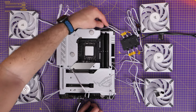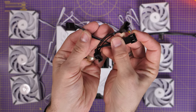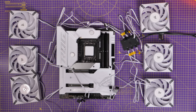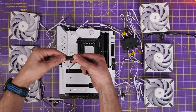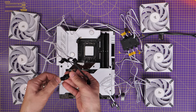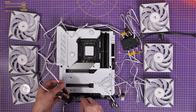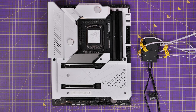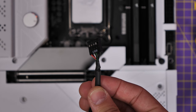You can see I'm filling up multiple motherboard ports quickly, but there are options. I have a separate additional splitter that takes three fans and connects them into one power cable, allowing three fans to share one header. These splitters are an additional purchase — they don't come with the fans or motherboard. You can also get Y splitters for two into one. You also need to check your motherboard's voltage output to confirm whether it can actually power two or three fans from a single header.